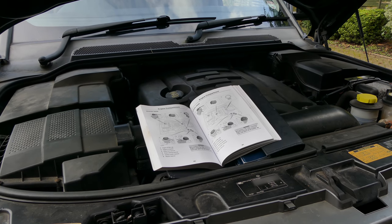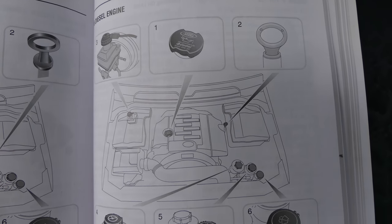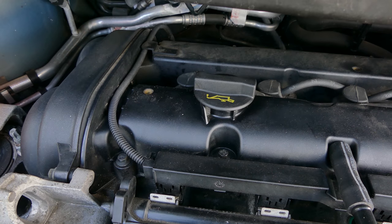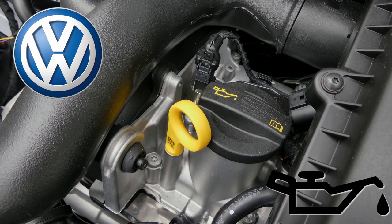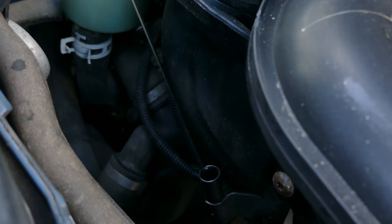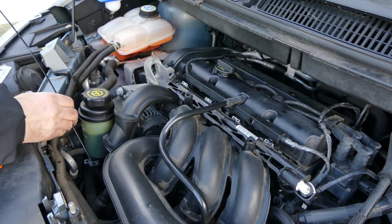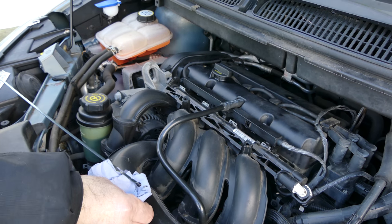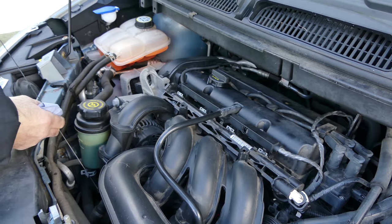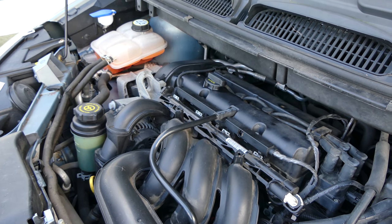In modern cars, many system parts are covered in shrouding or hidden behind plastic panels, so remember you can check your car handbook for the exact location of each item. On the top of the engine, roughly in the centre, will be the oil filler cap — a large plastic cap which will usually have an oil can pictogram and 'engine oil' or similar shown on it. Sometimes the manufacturer will helpfully put the correct oil type on it for you as well. Before you randomly add some oil, you'll need to check whether the engine actually needs a top-up. To check this, you use the oil dipstick — a thin piece of metal that literally gets dipped into the oil to see how deep it is at the bottom of the engine. The dipstick has the minimum and maximum oil levels engraved on it, and it's between these levels that your oil should be. Remember, your engine must have been turned off and stationary for at least five minutes to allow the oil to settle before the dipstick can give you an accurate reading.